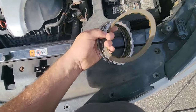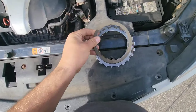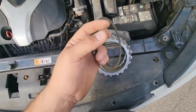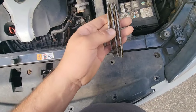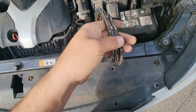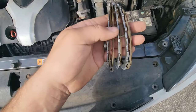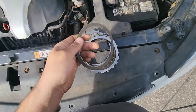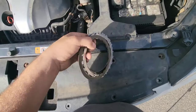But with time, those clutches get thinner and thinner and thinner, so you can have a problem, because if you flush all that nasty fluid and remove all the metal particles inside of the oil, you're gonna lose some grip, because what makes the transmission move is the fact that all those clutches are tight together. So if you replace that with brand new fluid without any debris in it, you can have a problem because your clutches are worn, they are used. So sometimes it is a bad thing to change your transmission fluid. This is why maintenance is the key for those transmissions.